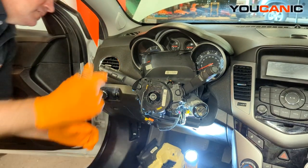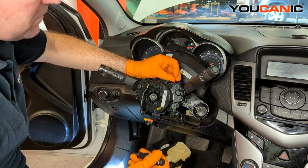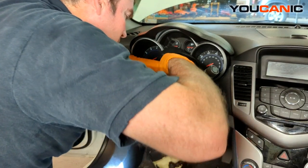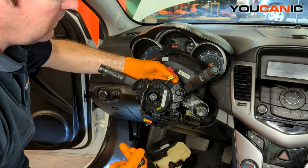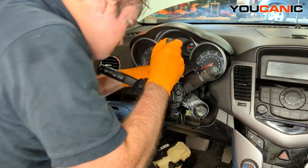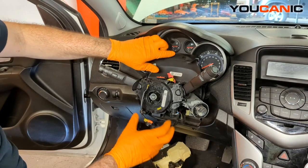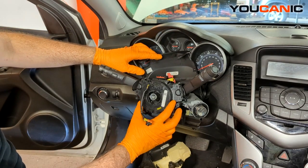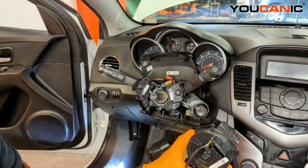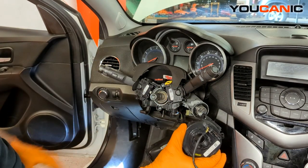Now we have the ones up top here, so we're going to pull to unhook. There's a red tab up top — you pull that backward. You probably don't need to pull it completely out, and that way we'll be able to depress the clamp right there to unhook that. Right there in the center is another clip that makes that electrical connection. Now we have that undone. We want to keep this in the straight-up orientation and pull this out for removal of your clock spring for replacement or to get to anything else behind here.